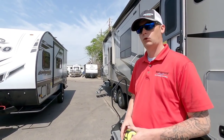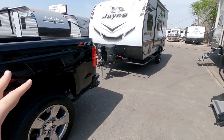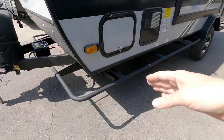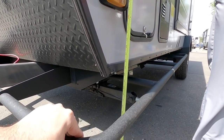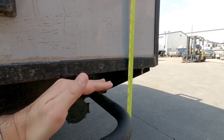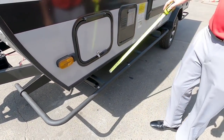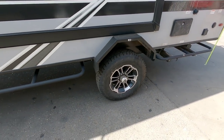I think you mentioned you have a leveling kit on your truck, right? So this truck's actually been leveled out. Typically the front would probably sit about an inch and a half lower than it currently does. With a leveling kit on here, this is going to be even more important — if there's any squat in the back after loading it up, you really want to distribute the weight properly so everything sits level. Coming to the trailer, we measure from this edge to the ground. We're right at 25 inches from the front. We need to raise the trailer's front up slightly to get it level — 26 inches front and back, about 26 and a quarter. So now we are perfectly level front to back with the trailer.